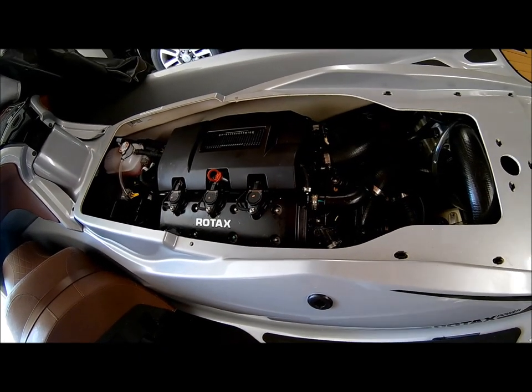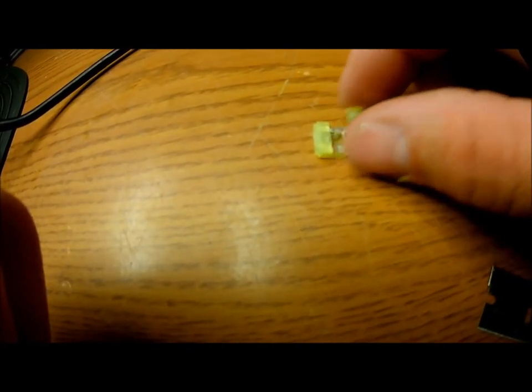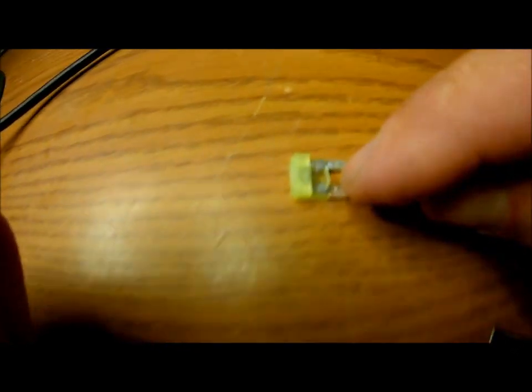To eliminate the fuse on the negative side, I took a higher-amp fuse and used a razor blade to slice it — removing the middle section — then took a second fuse, cut one leg off, laid it across, and soldered it at both ends. I slid heat shrink over the whole thing and shrunk it down, creating a DIY bus bar. Then I removed the fuse on the negative side and plugged in this bus bar, following the Sea-Doo manual for their pump installation. I'll put a link to their manual in the description below.